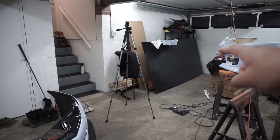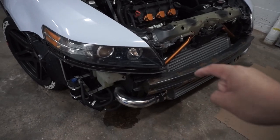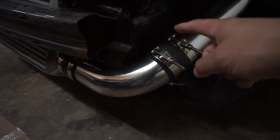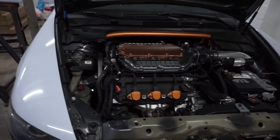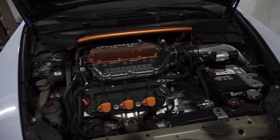Once this bumper goes on, I bought a three-eighth inch thick ABS to replace the quarter-inch HDPE splitter on my old bumper, and that's going to be chassis-mounted this time. I'm going to make my own brackets and tap into here — same thing on the other side. This will be a functional chassis-mounted splitter, and I have a few more things I'm going to do to spice up the engine bay. After that I'll call it a year for the summer.